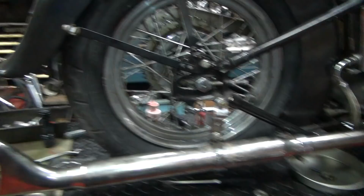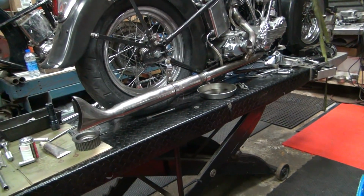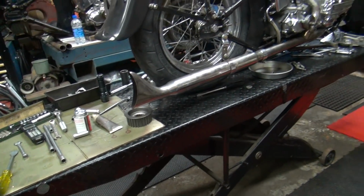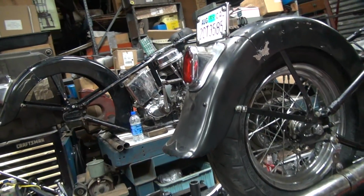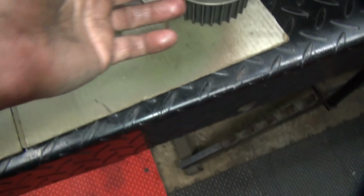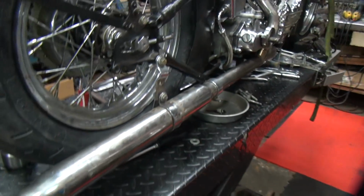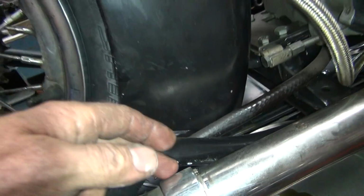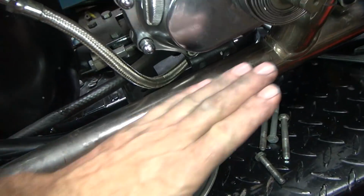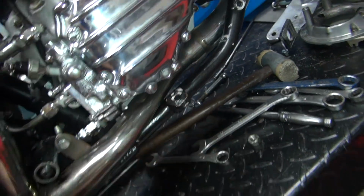All right, so there's the problem with the pipe, as you can see it's angled downhill. And it hangs back pretty far too, so if I start doing wheelies taking off because of traction, I'm gonna have a problem. It's gonna cause me to crash and this thing digs in back here. See, this tip's all digging already. It's already been digging in on something. So we're hitting right here on the frame, which is one problem. The other problem is if you angle this pipe back up this way, it knocks the pipe out up in here, which we can't have.